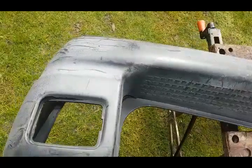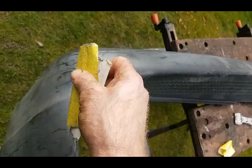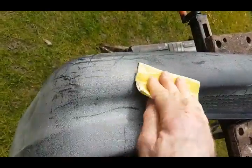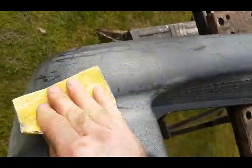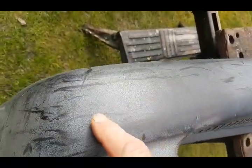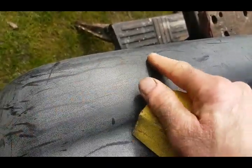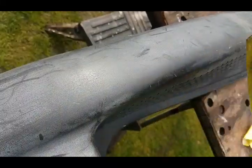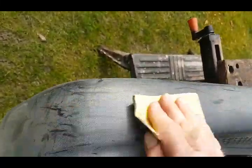Now I'm going to go over the whole bumper. This is where it's been well used, but it's 80 grit paper. You don't have to go through too many grits — the idea is to create a bit of abrasion to put a key in for the first coat of etch primer. That's all you want to do — go over the whole lot to create a key.